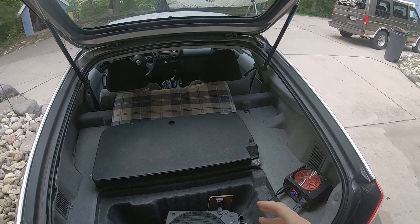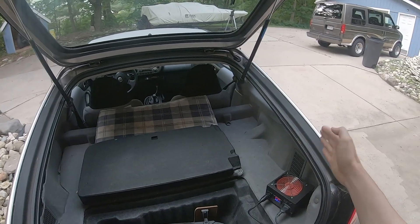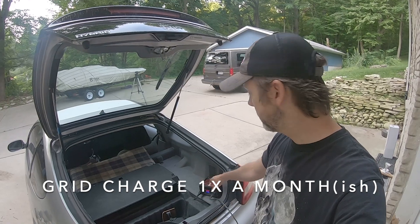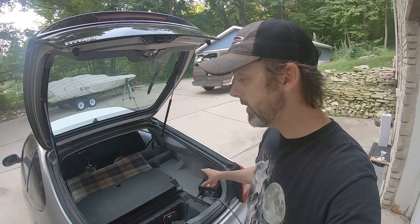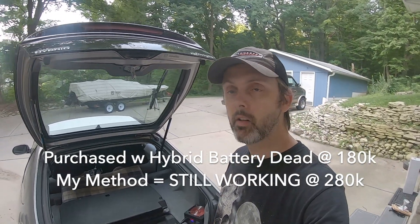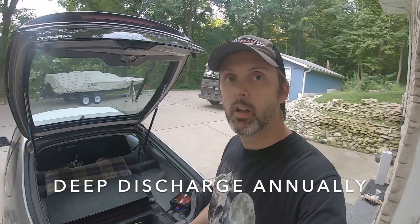The reason we're doing that is these batteries have a memory, so to speak. What you want to do is really exercise the low end and the high end. This will basically renew the battery enough that it will be perfectly drivable for a few months, and then once a month or so you'll have to plug it in overnight. So far I've had this thing seven years — I bought it with 180,000 miles and a completely not-working battery. Now I have 289,000 miles and it's still working. Generally I have to do this deep discharge about once a year; I do it in the summer because it's nice out.